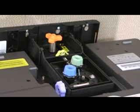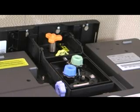Then recheck the 3 adjustment restrictors at the top of the projector, and the projector stabilizer bar at the bottom of the projector. Confirm that these adjustment restrictors are not engaged and are not restricting adjustment movement. Also check to see if there are any other obstructions getting in the way of the projector movements. Some obstructions may include cables which are not routed correctly.